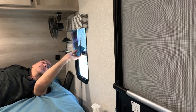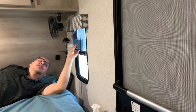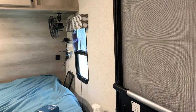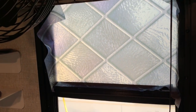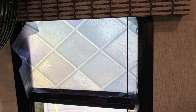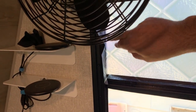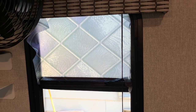And once you get it there — once it's mostly done like that, let me show you a little zoom up of it. So most of the bubbles are out of the center, pretty much everything is. And we just got to kind of lay on the edge there. I'm going to do the bottom one now and let that dry a little bit. Then when I get the bottom one done, I'll go back to the top, take a razor blade and cut the edges so it fits really nice in there. And then once that's done, I'll give it one more squeegee and they'll be done.